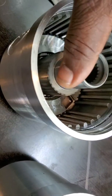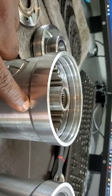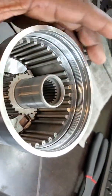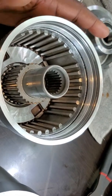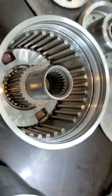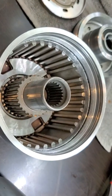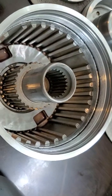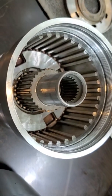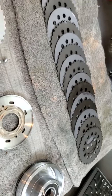Essentially, you will take your OEM coupler apart — it's pretty easily done. You can cut along the base here at this segmented line, all the way around, and utilize the parts that we provide in your coupler kit. Now, this coupler is not a fully assembled coupler. The listings we created showed we made a case, a lid, and clutches. This is literally a kit to replace your OEM non-serviceable coupler with an aftermarket serviceable coupler with aftermarket clutches. Made out of billet — it's much stronger.